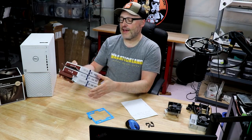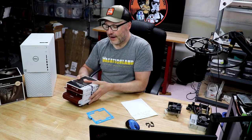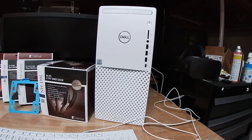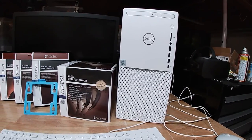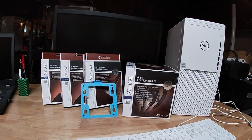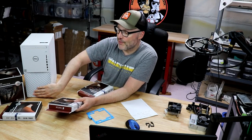Over here I have a pile of fans. Right now this thing only has one fan in the back — an 80 millimeter fan, and it's a wimpy one at that. There's not a lot of opportunity for hot air to get out. Based on the suggestions from that thread, to replace the rear fan we have a 92 millimeter fan — this is an NF-A9. I'll give the complete list in the description. We also have an 80 millimeter NF-A8. The hope is that by moving some wires around, maybe we can fit it in the front to get airflow across the RTX 3070.